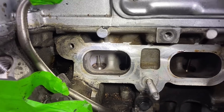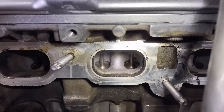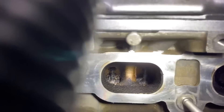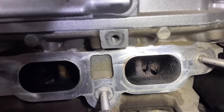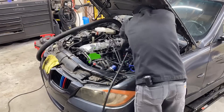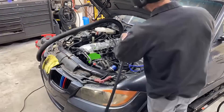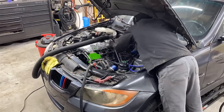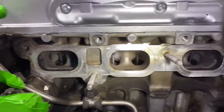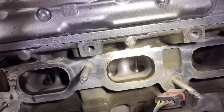Here's a status update on the first four cylinders after cleaning. This media blaster has been great — the large size hopper meant I haven't had to refill it at all. One interesting thing to note is the last two cylinders on this car are the cleanest — not nearly as much carbon on those as the front four. Also, don't wait to do cylinder number six last — it's the hardest to get to and the vacuum attachment doesn't fit in there well. I did it second to last so I could finish with the easier cylinder five. There you have it — all six cylinders cleaned up and minty fresh. This happens about every 60 to 100k, so if you have a BMW N54 I'd recommend giving it a try yourself.